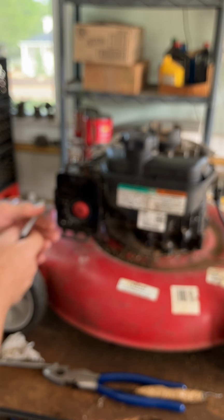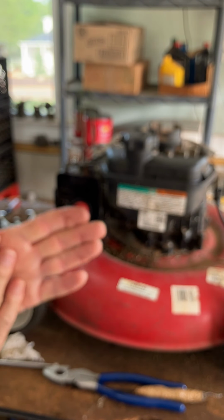Okay, I'm not going to seat these. Really, what I'm most concerned about is seating this one and the one way down here, which seals this to that carburetor. That's the main seal you want. If you're taking this thing apart, it's these short little screws here that attach to that. I'll show you what he had in there. He had this little tiny wood screw trying to hold that on. It didn't attach to anything.